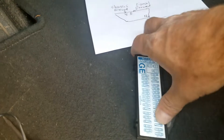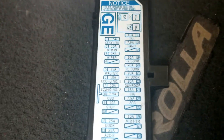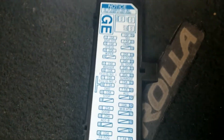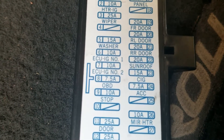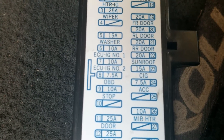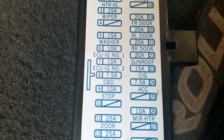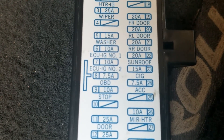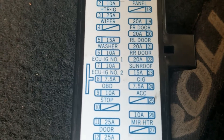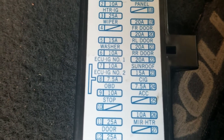If you're not getting power to the OBD2 port, the next thing to do is look at your fuses and find anything that says OBD2 or is related to the port. For example, on this 2012 Toyota Corolla, right there it says OBD — it's fuse number 8 underneath the dashboard. The label on your vehicle might be more vague, so you may need to do a little research to find the right fuse.